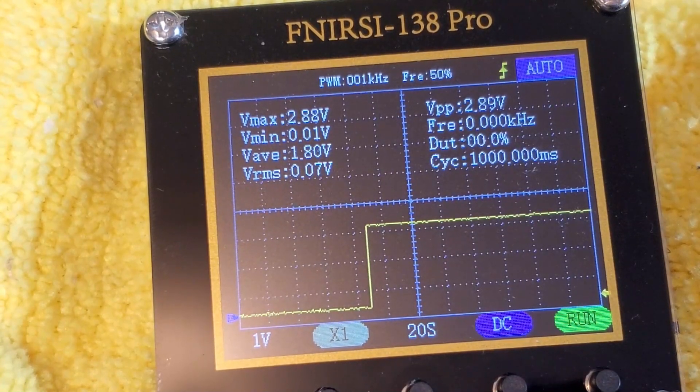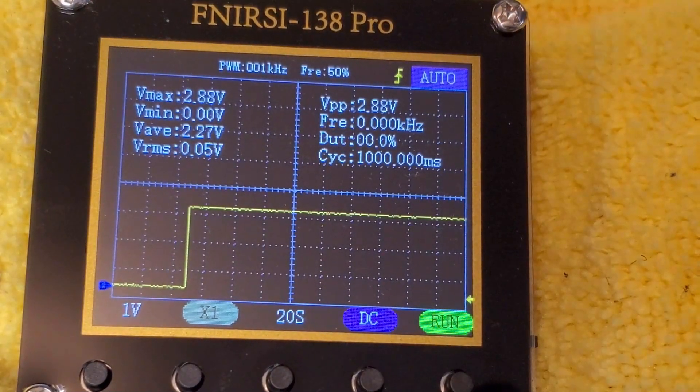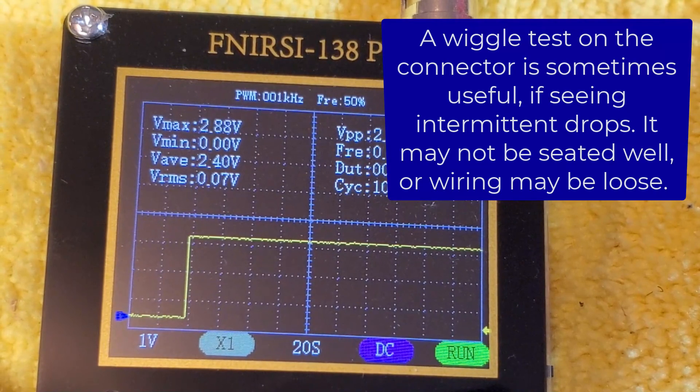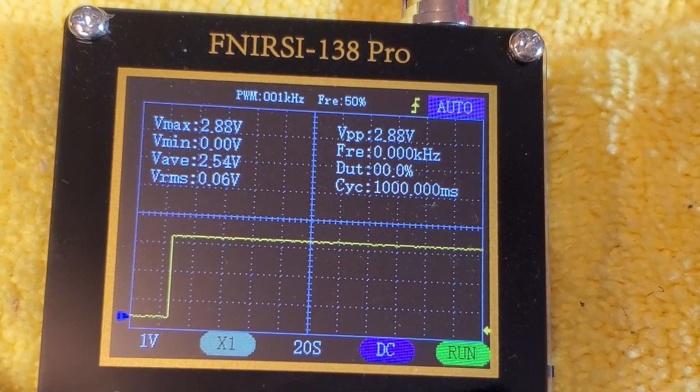Now I have the connector plugged in and we're seeing about 2.8 volts. As the engine warms up, we're going to see this voltage change, and just like I did with the OBD2 reader, I would watch for any dramatic dips. I don't see any here — it's pretty stable. But if we did see the voltage dropping off a lot, that might lead us to believe there's a cabling issue or the connectors aren't seated very well. I don't usually run the oscilloscope at 20 seconds per division — it's a pretty slow time scale — but I'm doing it so we can see that gradual slope as the voltage changes as the engine warms up.